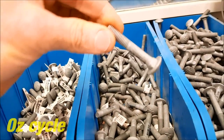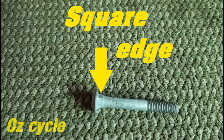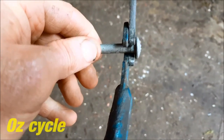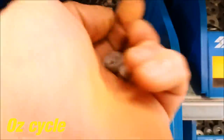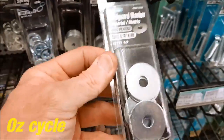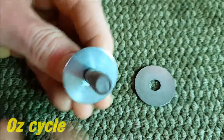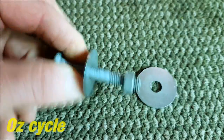So take yourself to the hardware store and grab a bolt — it's called a cup head bolt. Make sure it's got a square collar on it so that it fits into the rear dropout; the collar prevents it from rotating all the way around. I measured the bolt length at 60mm, but you can go anywhere from 50 to 100mm. Grab a nut for that bolt — I'm grabbing two, one for a spare — and two wide flange washers. The bolt was 69 cents, the washers were 37 cents each, and the nuts were 50 cents each — a total of $2.43 so far.